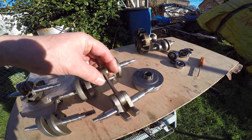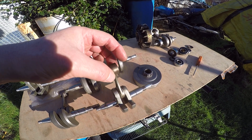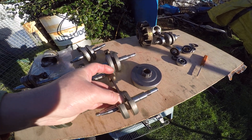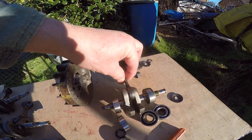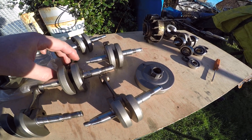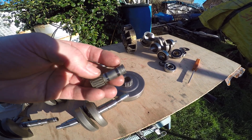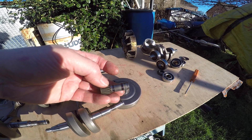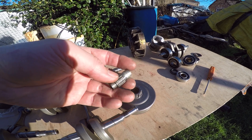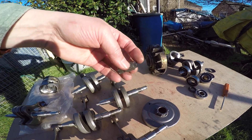This is more or less what it should look like as standard — it's just been given a quick wash off, not specially cleaned. You can't remove that blue colour unless you remove the surface of the metal. It also happens on the wrist pin — you can see these bands of bright blue colour, but in the areas where it rubs, the surface discolouration has been removed. That's the small end bearing; this is the gudgeon pin, or wrist pin, or piston pin, depending on where you come from and what you've been taught.